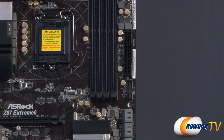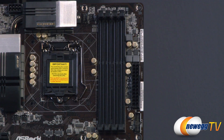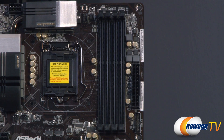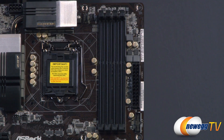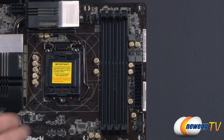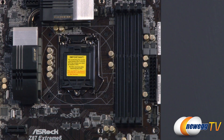Above that you have the 24-pin main motherboard power connector, and just to the left are the DDR3 DIMM slots. The board supports up to 32GB of DDR3 — up to 8GB per DIMM — in dual channel, so buy sticks in sets of at least two. Officially Intel supports DDR3 up to 1600, but if you're interested in overclocking your memory, this board supports up to DDR3 3000, though DIMMs that fast are very hard to find.